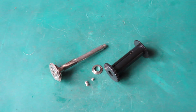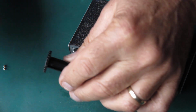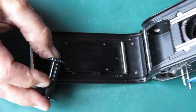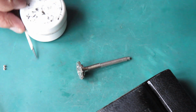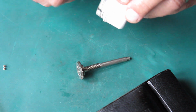This has to be greased with graphite grease, typically I use, although if you can't get it you can use just about anything you like. Right, stage 1. Take the nicely cleaned take-up spool, which I only ever wipe very lightly at the base to get rid of any grease with naphtha, and I never use anything more wicked than naphtha on that. Any solvents tend to eat plastic, so I found that I get away with that nicely. That works well. Right, so graphite grease.